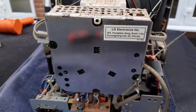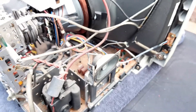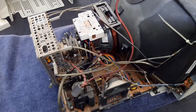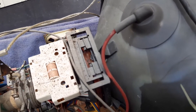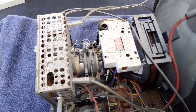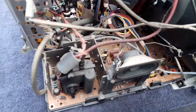The quality of the image is actually very nice. One point of advice: whenever dealing with CRT monitors, always be careful with the tube area. CRT monitors operate basically like a large capacitor and can hold charge even after being turned off for a long period of time. Always make sure they are discharged before working on them, because they can really, really hurt — they can actually kill you.